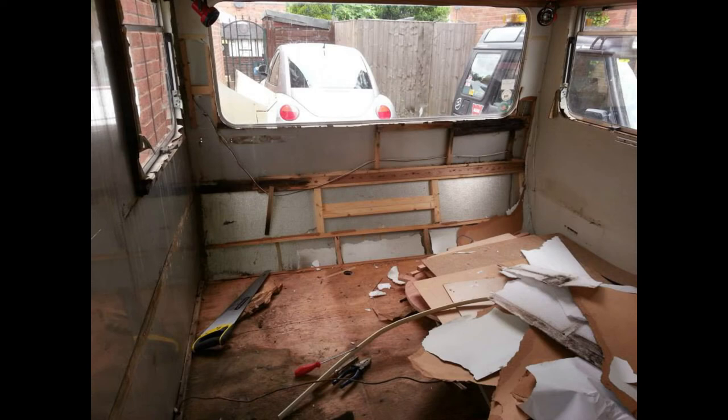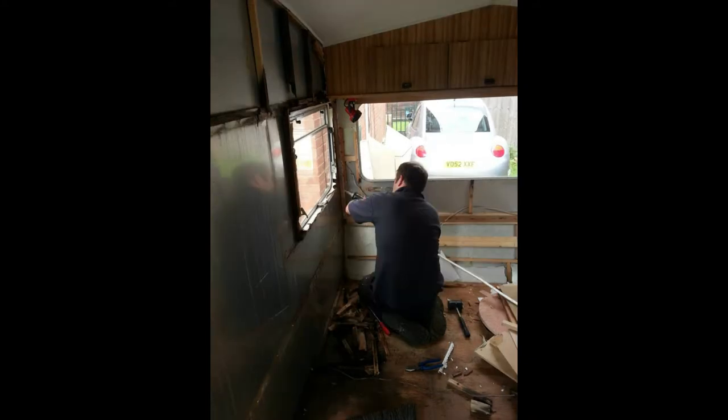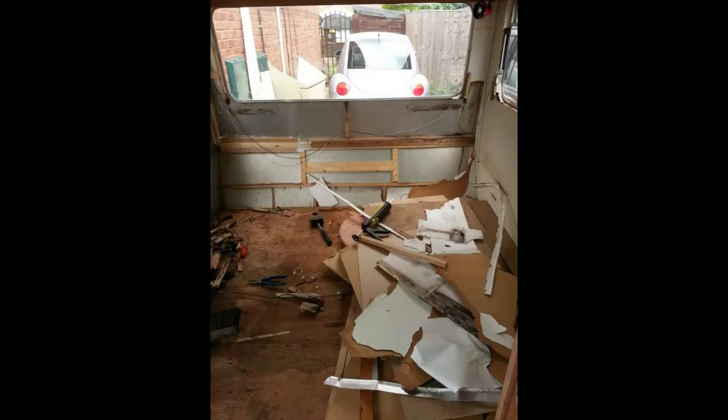These are the sort of strips — all the caravans were made in panels. That's the inside, that's the front end, starting to do the panels. You can see the dark black wood that's all rotten, some of it just flaking away. I'm starting to put back in — I can see with my sealant gun I'm using Sikaflex to bond it back to the aluminium walls, starting to build it back up.